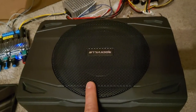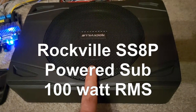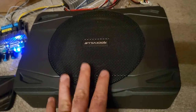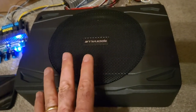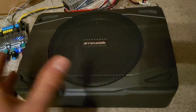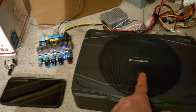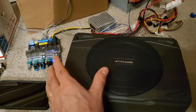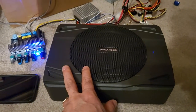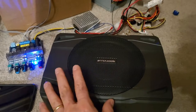This is a Rockville eight-inch amp — I'll put the model number up. It's very inexpensive and seems to work very well. It's not going to give you door-rattling bass, but it does fill out the sound very nicely in the low end, basically 150 Hz and below. It gives you depth and makes these little speakers sound a lot fuller. Now I could have made an enclosure for a regular subwoofer and built something that would fit — a floor sub or a trunk sub — but this is not an audio car; I didn't want to add weight.